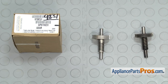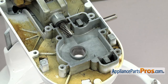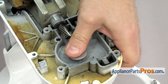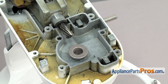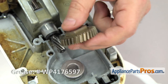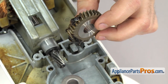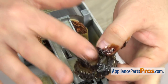Here's the old worm gear next to the new one. If you already have one of these, great. If not, you can get it at AppliancePartsPros.com. In order to put the gear case back together, we're going to first push in the planetary shaft bearing. All you have to do is set it down into place and make sure you push it all the way down so it seats. Then we can lift the planetary assembly back up from the bottom. The first gear that we have to put on once we push the planetary up into place is the worm follower gear. So we're just going to grease it up and have it ready so that when the shaft comes up, we can set it down in place and put the pin in to hold the planetary shaft in place. Once you have it greased up, you can set it aside.